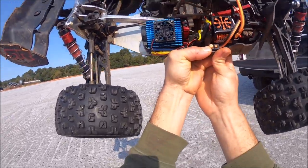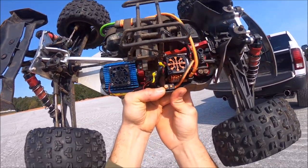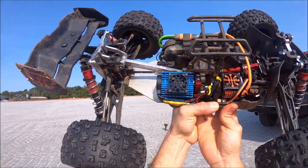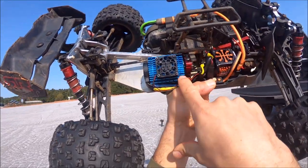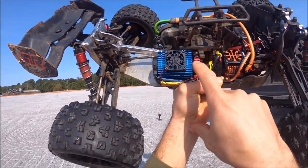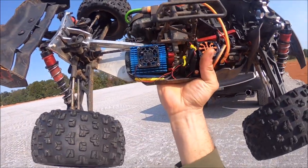temps go. I got a 17 tooth pinion on it right now with these stock Copperhead 2 tires. I may throw some Badlands on it and gear up a little bit just to get a different feel, but we'll see how it does. And I got the fans on here. I was able to use the Hobbywing heat sink because the Arrma heat sink wouldn't fit with this tower, and then I just installed the little fan on top of it, so we'll see how long that holds